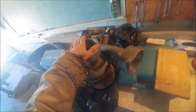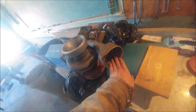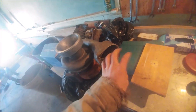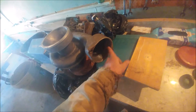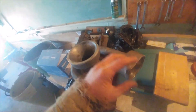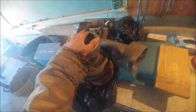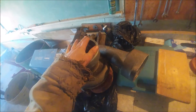The question is whether it's the wrong mapped turbo for the fueling of the motor or something else. One thing we noticed is this slip connector coupler — a double O-ring fitting that goes on here. The elbow on the turbo that came off the truck was really worn, so we're wondering about boost loss there. It's building about 20 to 24 pounds depending on load, but still not flowing enough to cool off the truck.